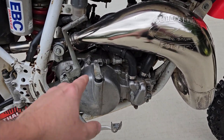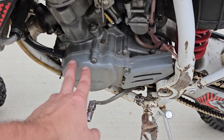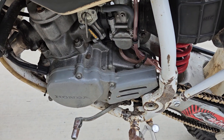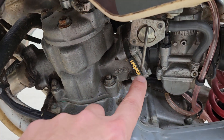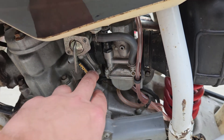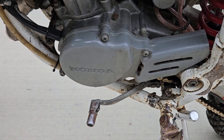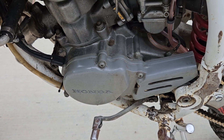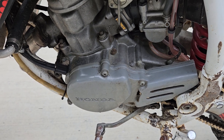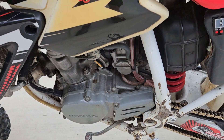I've sprayed ether all around the intake. I've had this cover off, sprayed ether around there, and the RPMs never pick up. I sprayed ether all through here — there's the V-Force reeds. These are all new gaskets. So my guess is there's a leak in the crankcase somewhere. We've never been able to figure it out. My dad and I kind of chalked it up as probably just needs new seals, but it's not really bad enough to really give a damn about for a CR80.